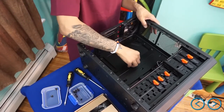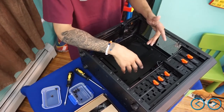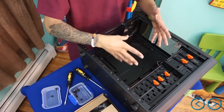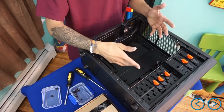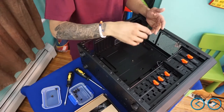If you look at the back panel, there is a metal standoff screw in the middle. Some cases don't come with this, but that middle screw is the positioning guide for where you drop your motherboard. If it's not there, check the bag of included screws and install that standoff screw in the middle first.